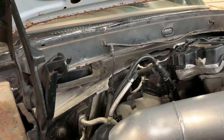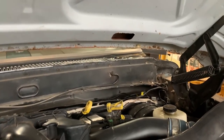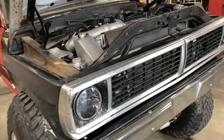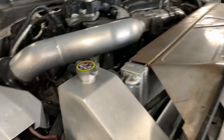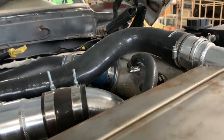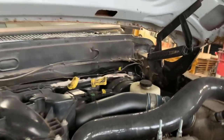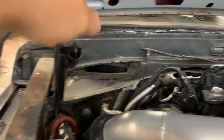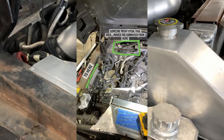In the back, you can see the '14 firewall is not connected to the '68 firewall — I didn't do that because of cutting and welding over the motor while everything was still in. When I pull everything apart, I'll fill that in. I moved the batteries to behind the back seat, built a custom secondary reservoir, and the primary reservoir for the radiator is a Mishimoto — I welded brackets on it to move it from the factory location. The intercooler is moved just slightly and we used the factory tube, just cut a little bit out. The ECM was back there — I cut and moved it inside the inner fender. AC works. The washer tank is off eBay with the factory '14 pump drilled into the bottom, so it plugs and plays into the '14 wire harness.